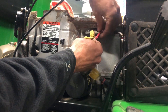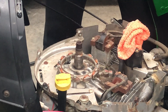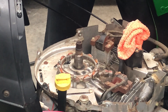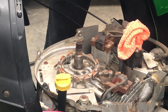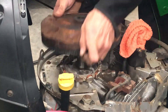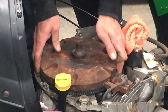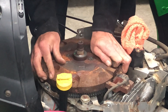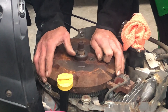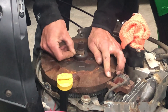Plug in your power wire — there you go. There are four bolts to do. I also switched the flywheel — took the flywheel off the other tractor just in case the magnets are a little stronger. They look the same to me but they had a different part number, so I'm going with it. Make sure the taper is all nice and clean. Line up the key — had to fight the magnets but she went in. Line up the key and slide it right in.